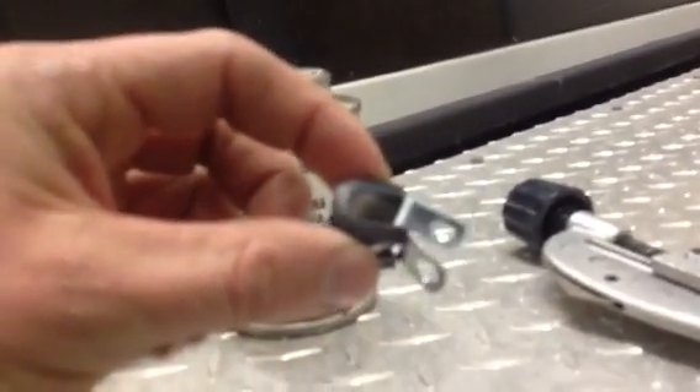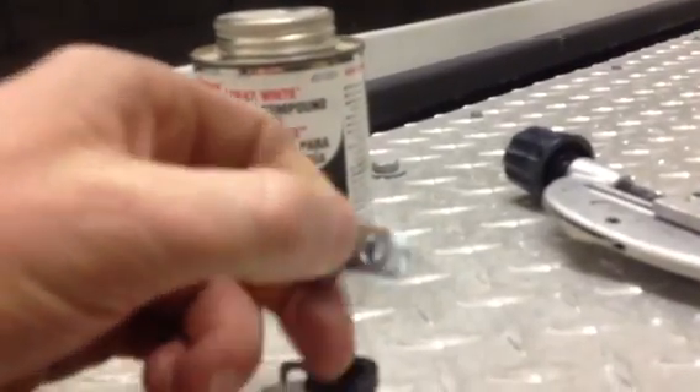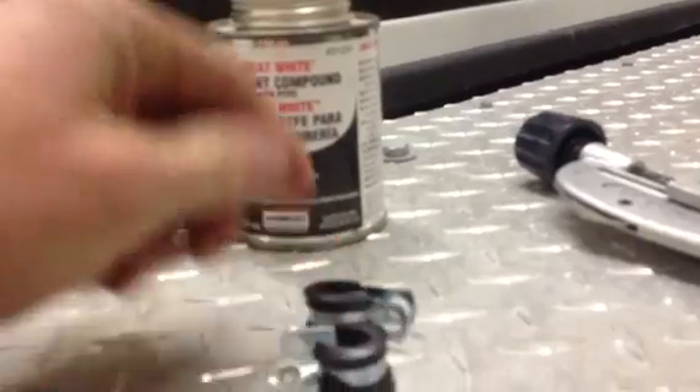Coil the bottom line and feed it down. Drill a three-quarter-inch hole through the bed. It's usually a good idea to put a piece of hose around the line where it goes through the bed so it's not rubbing against raw metal. Underneath the truck, keep the line running between the frame and bed. In your kit you'll have a few grommet fasteners — put those around the line and self-tap them into the body underneath to keep the line from rubbing on metal.